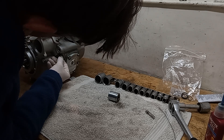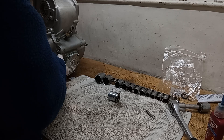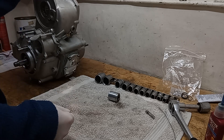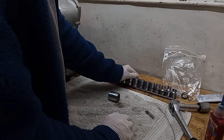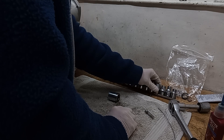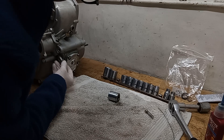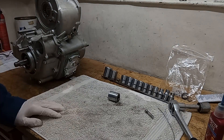People say there could be an airlock and the pump can't suck the oil. That's never happened on my bike, but it's a possibility - like anything's a possibility. What you can do - and what I did on my Commando - is fit an oil pressure gauge. So I now know definitively whether or not I've got oil pressure. As soon as the bike starts up, I know I've got oil pressure. If you're worried at all about oil pressure, put an oil pressure gauge and you can tell straight away.